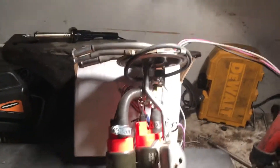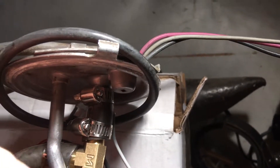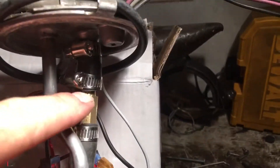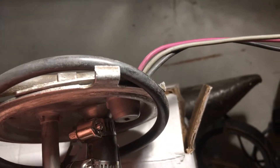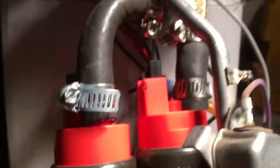So here's my budget version of the double pumper fuel pump. The fuel supply or main fuel pump pumps and goes to the main fuel line right here. I've basically got a T fitting which went right here — T fitting here to connect the main fuel line to the first pump. Then the side part of the T fitting comes to the side and goes to the second fuel pump.